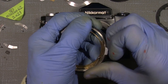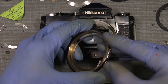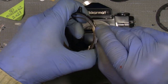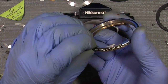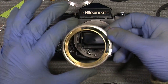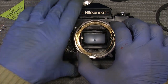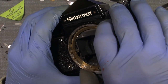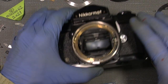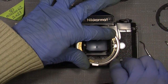Wow, seems to be much better! Now you can actually move the ASA ring — not too soft, you have to use a little force, but now it works. That's great. Now I can simply put this ring on and remember to align the mark for the shutter A gearing and the shutter B gear. Much better — it should work.